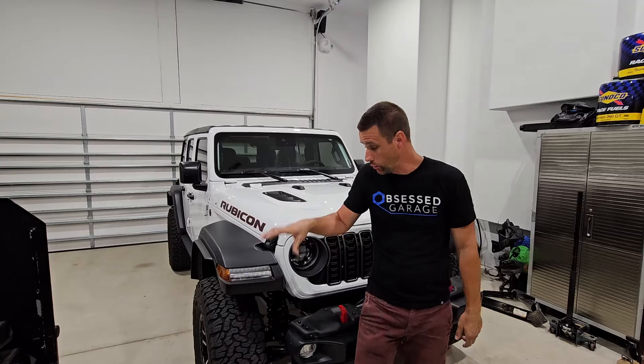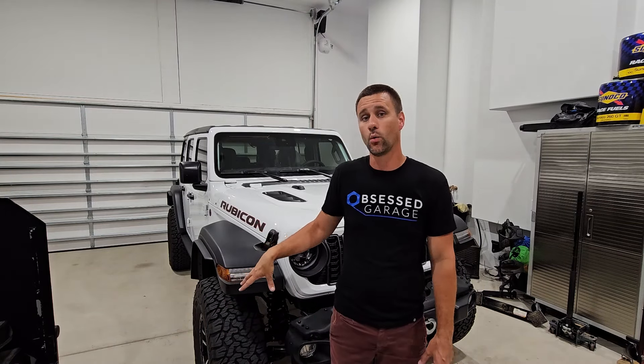The whole point in reducing tire pressure on big wide off-road wheels and tires is to get even tire wear. If the whole tire is not evenly touching the ground, we're going to wear out the center of the tread before the sides ever touch the ground. That's the issue with running 37-plus PSI with these wide tires — the edges aren't even on the ground.